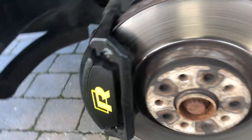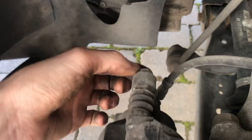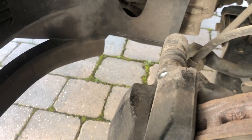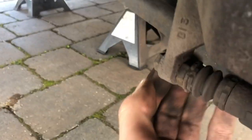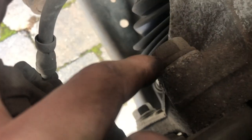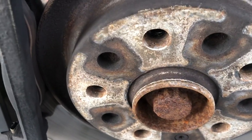Wheels are already off. What I've done so far is used a flathead screwdriver to bar the caliper back a little bit so it slides off nicely. Next, there's a 13mm bolt and a 17mm nut - put the 17 over there, hold it with a spanner, and undo the 13mm at the back top and bottom, which lets you get the caliper off. After that we're going to undo what looks like 22s to take the carrier off, and then we've got a Torx bit to smash out the disc.